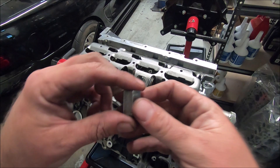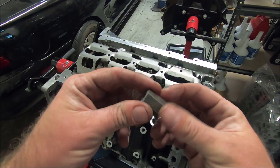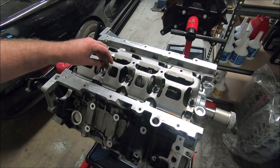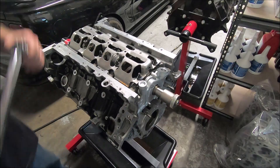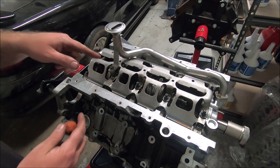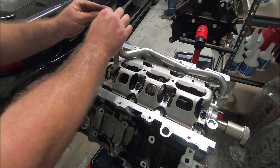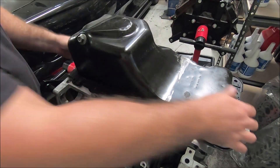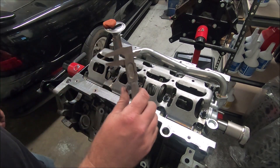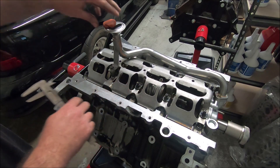Here's the little hex piece spacer — grind it down on both sides to get it closer to only having threads and we'll see what that gets us. I got a combination of washers and lock washers that I like — puts the thread depth equal on either side. That gives us 3/8 inch which, when you put the pan gasket and cinch it down, that should put us perfect.